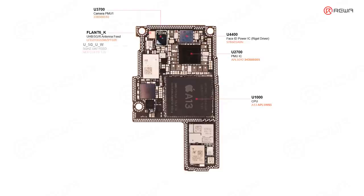These two are also related with the Wi-Fi or RF circuit, which we'll cover in those lessons. And this very tiny chip is very important — it's the Boost IC, used for providing the PPVDD boost, which is an essential power supply for many components. If this one gets damaged, the phone cannot be booted up.